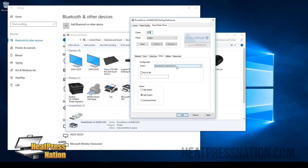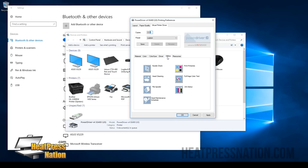The driver is always going to print from this printer right here, so make sure it's printing from the right one. You can always change the speed, the quality, or advanced photo depending on how you like it. Just remember, if you do advanced photo, it's going to use more ink than usual. If you have some parts of your image that are missing some inks, you might need to do a nozzle check. Head cleaning is needed if you're getting streaking — for example, if you leave your printer off for several days or weeks, you might get what's called banding, which are lines showing in your print indicating that your print heads are dried out.